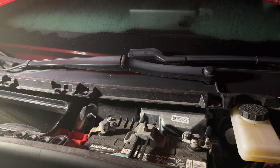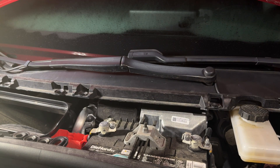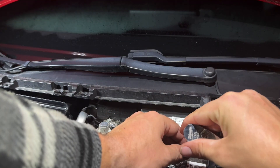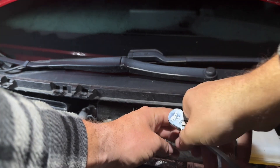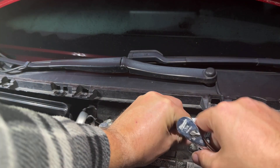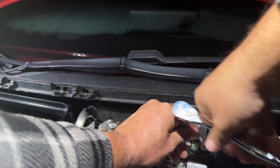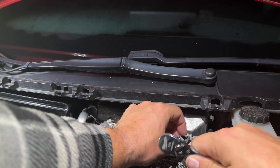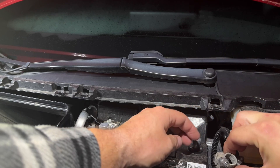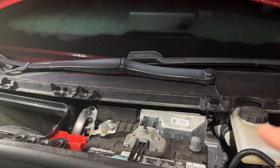So the car is dead. As the next step, Tesla wants you to disconnect the negative terminal. This should be a number 10 — a 10mm. Here's our negative terminal coming off. We're going to get that somewhere that it can't touch anything.